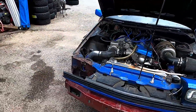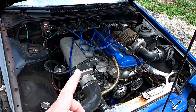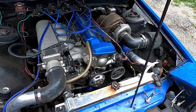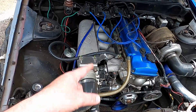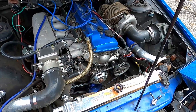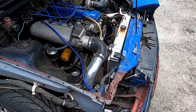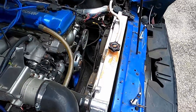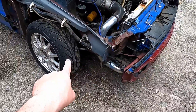This is an S12 hatchback. He drove it with a single cam KA for a while, and when that finally let go, he put this in. This is a dual cam KA with a big old turbo, Excessive Manufacturing intake. It's got a built bottom end, stock head. A bunch of S13 parts you can make fit on an S12, like the Mishimoto radiator — that's from an S13. When we get on the lift, we'll go over the suspension.